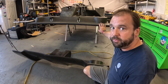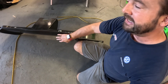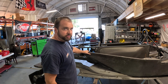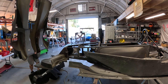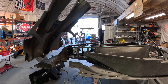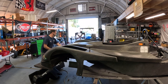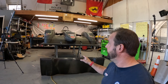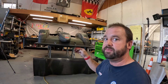The other thing is, with this flat splitter, if you put it on the ground you can stall the front splitter and it can result in porpoising. Whereas with this one, it has these lower edges here, so if I just touch here, it still doesn't stall the majority of the front diffuser. Now that we've got the actual side pods bolted on at the front and our front splitter on and hung, we're going to grab the center section and the front fenders and see if I can just gently load them onto the car. The front end doesn't fit too bad — it's definitely not perfect, but what I am worried about is trying to get some of these body pins into the actual center section and fenders to mount them to the side pods I just put on the car.